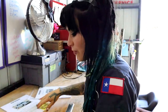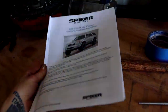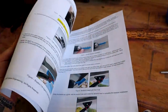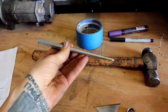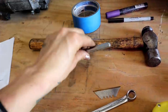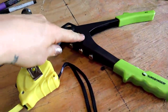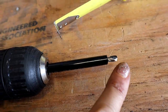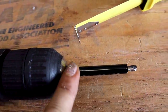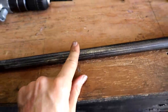I'm gonna put the Tacoma stuff aside because I'm not using that today. Here are all the tools I used: a very thorough installation manual with color pictures, painter's tape, a permanent marker and a purple marker, a ball-peen hammer and a punch — a center punch would be better but this one worked fine — a razor blade, a 12 millimeter wrench, a tape measure, a riveting device, and the rivets came with the kit. Also a drill — mine is air operated but battery works too — a number 10 drill bit, and a cut-to-length drill bit stopper.